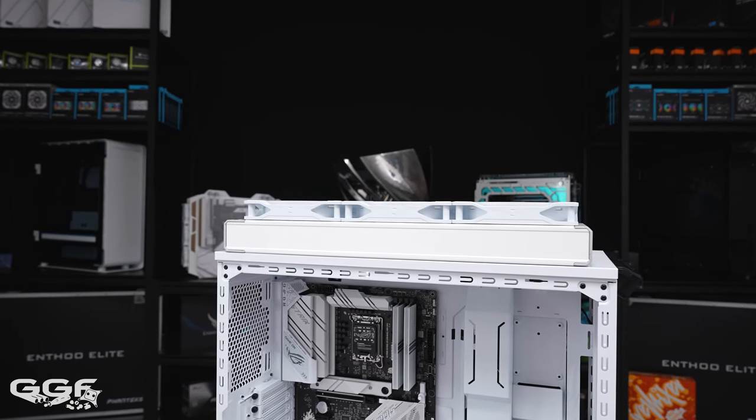So that's pretty much the build — something clean and simple. I really wanted to contrast the white chassis with blue coolant, and then a pinkish-red for the RGB lighting on the fans and memory. The only slight modding I did was a pass-through port at the bottom from the outlet to the GPU. By flipping the radiator I could route down that port, then soft tubing to the front port on the front radiator, and the back port has soft tube going up to the back port on the top radiator — it just cleans it up really nicely.